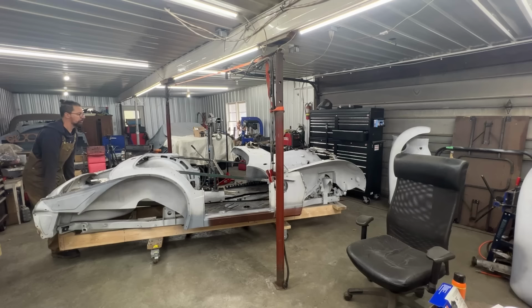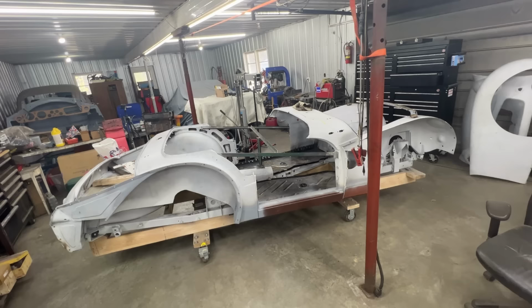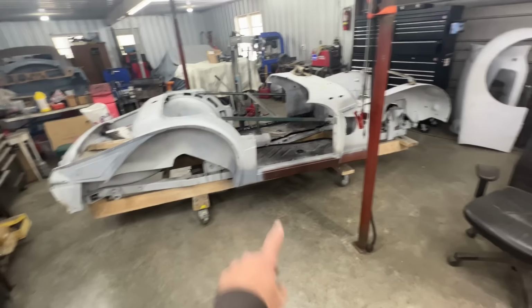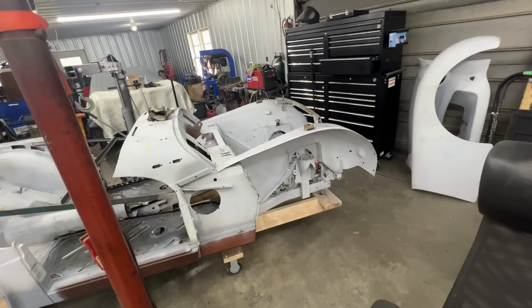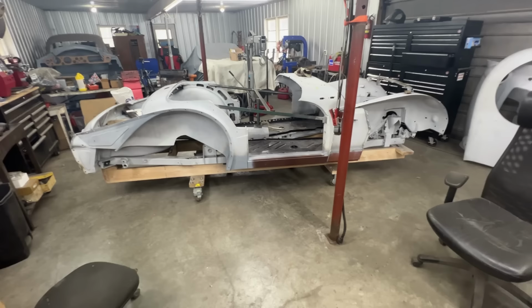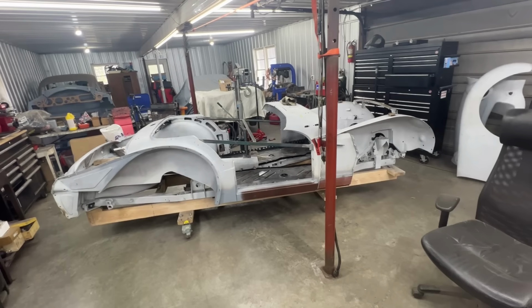It is a pretty light body actually. So I think I'm gonna use 4, plus we don't need to lift it too high. I mean, the rear end needs to go a little bit higher so the body can come above these shock mounts. The front end needs to come a little bit higher. Actually, not really. I think it only needs to go up by like 6-7-10 inches, let's say, not even a foot. And I'm gonna be able to slide the frame out and come this way. So I'm just gonna use 4 straps, that's all.